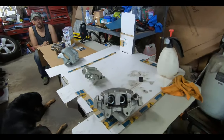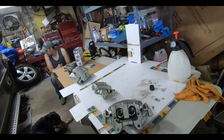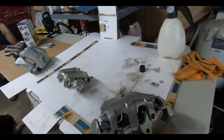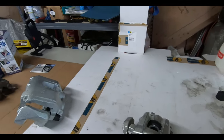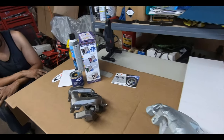You want it to level out. So we want to give it enough time to level out, and we want it thick enough to where the paint levels out after you brush it on. We don't want to see brush strokes in it. We don't want to see lumpy paint work, because when we do our spraying out of our calipers, they're very smooth and very nice, which is the way I want these to come out.